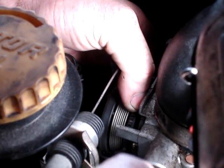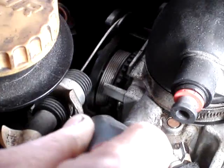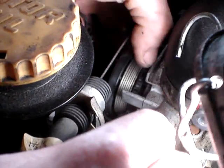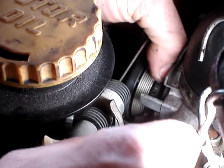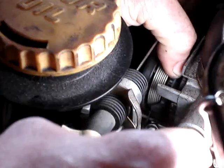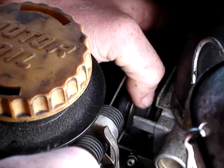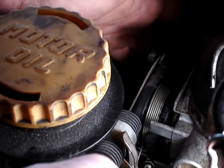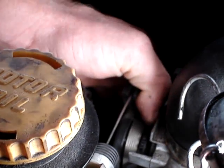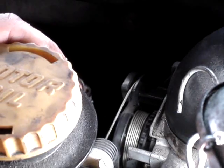Rotate it back towards the rear of the vehicle, and by doing this — moving it a little bit to the side — you rotate that back until you hear it pop. And now, when you move the throttle body cable, you'll notice that the cogged wheel does not move. And that's exactly how you reset the throttle body limp home mode.